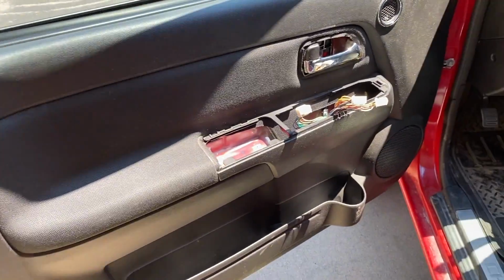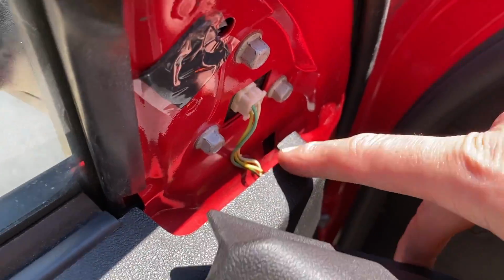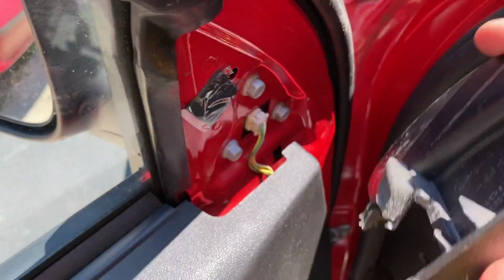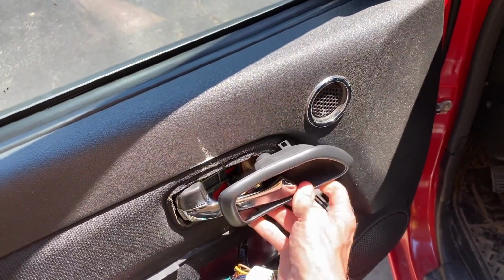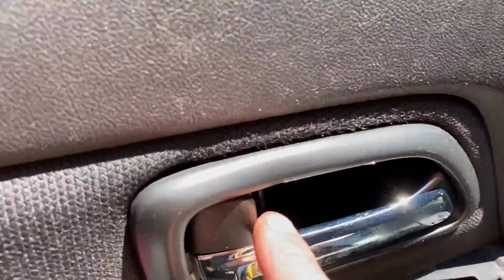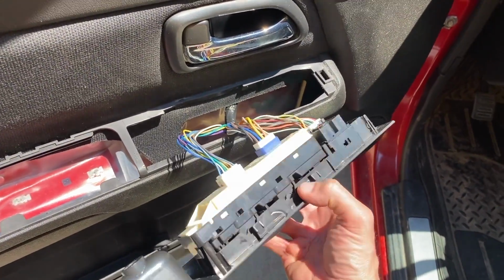Now that we have the door panel secured, grab the corner piece here. You've got that little tab right there. That actually goes into that lower slot there. And the internal plastic securing tab goes right in that hole. Align it properly and secure it. From here, we'll carefully maneuver the plastic covering to the door handle in place and secure it with that Phillips screw. Next, grab this entire unit here and resecure the 3 connection points.